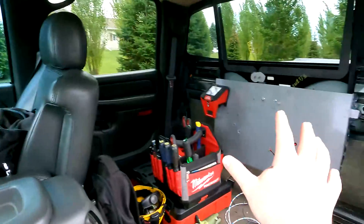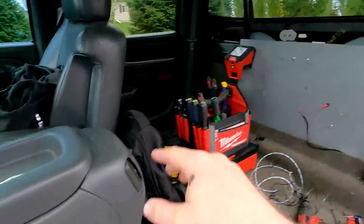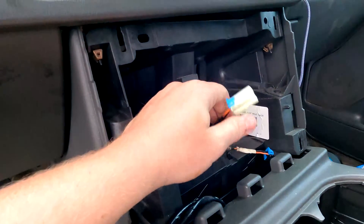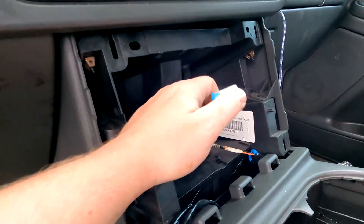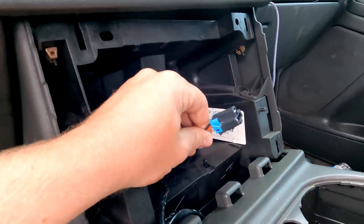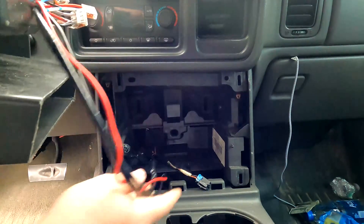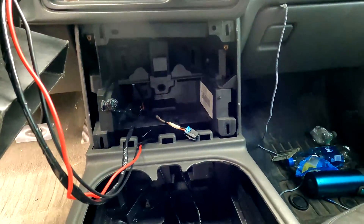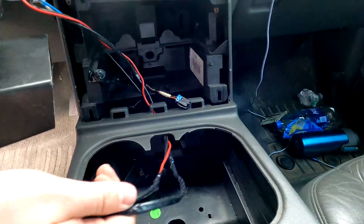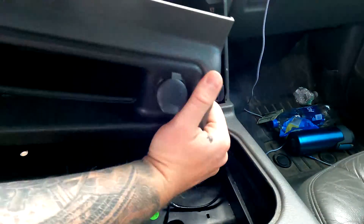That jumper is what enables the motor to go up and down. Now I'm not going to hook up or cut the cigarette lighter — I'm just going to tape it up and plug my 12-volt power back in. All this extra wire is going to tuck down in here. You can see it coming up through here — I'll keep it all tucked down so that when I have to pull this out in the future, it'll pull out nice and easy.